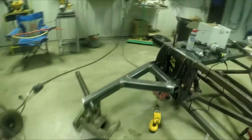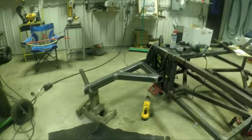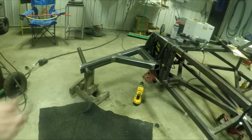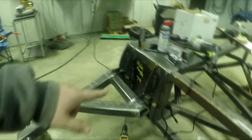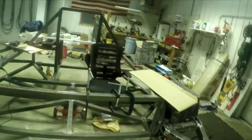7 degrees, that's kind of how I want the ride angle to be to match the model and aesthetically. But then the axle is level with the ground to make the built-in caster and camber of the kingpin work in normal steering conditions. And I will make sure that the A-arm stays at this 7 degree angle when I adjust my shocks and have full ride weight on this unit.